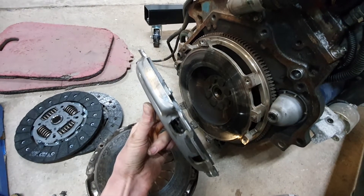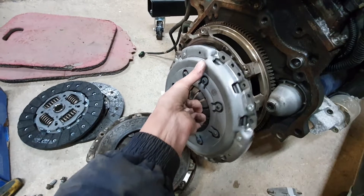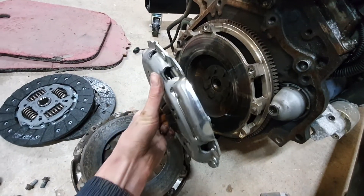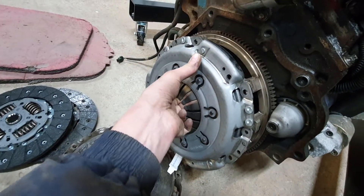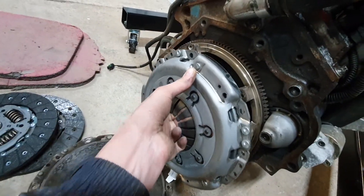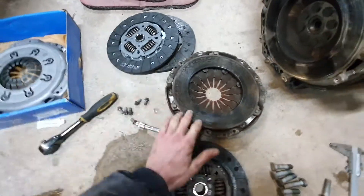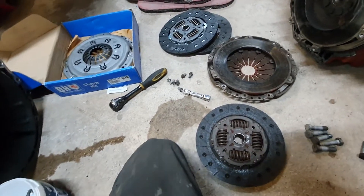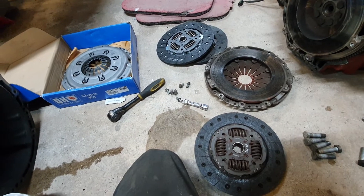Let's have a look at whether the pressure plate fits. I can't see where they are locating... Oh, there's a locating feature... No, I don't think it will fit. I could drill those out — I'll have to have a look at that off video. It'd be nice to fit a new pressure plate, but it's not necessary; I can carry on with the existing one. So that's the clutch issue — I'll whip that together, align the clutch, pop the gearbox back on, and really the engine is ready to go back in.